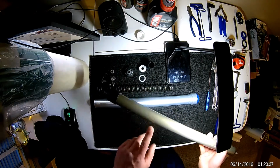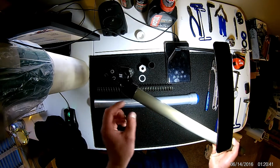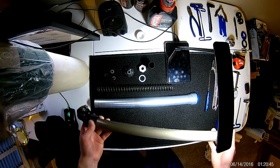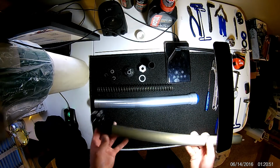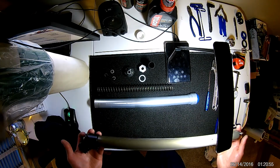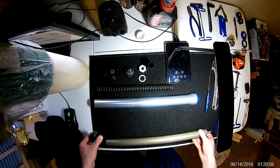You could see this kind of anodizing color on the inside of the tube. The bottom looked black, and that was all just dirt and sediment, or whatever has accumulated in this tube over time settles at the bottom. So I like to pull the cartridge out and just clean everything you can. That way we know we have a really good rebuild on this fork.